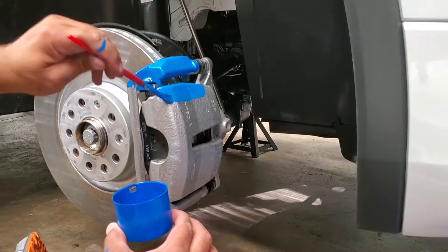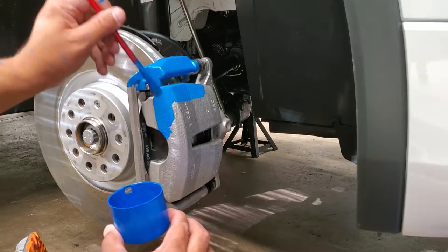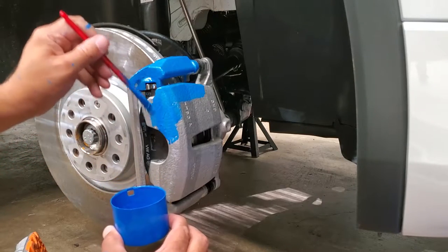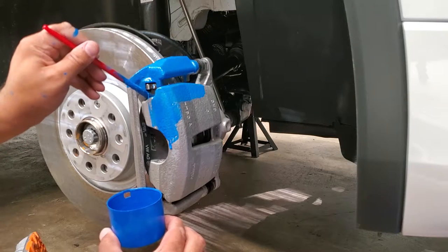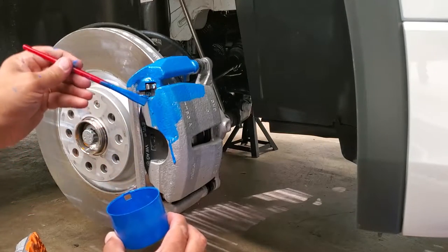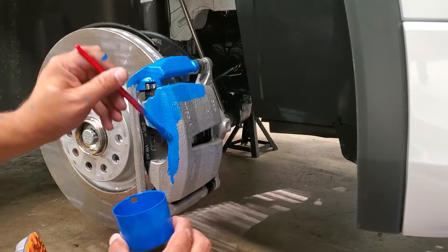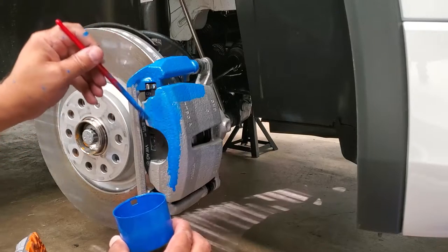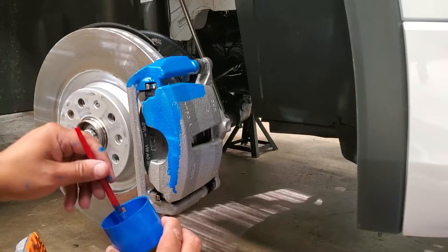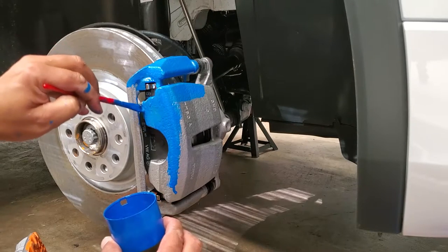As it dries it gets more shiny. Right now while I'm painting, it kind of smears and leaves a lot of silver showing through. Once you get to the second coat the smearing stops because it'll be dry and it starts getting thicker and shinier blue. You can go right up to the brake pad just by pushing the paintbrush — no need to mask. This is just the easiest way, and it's how we've done it on the Mazda 3 and the Honda Ridgeline with good results.